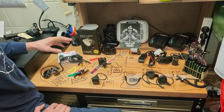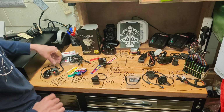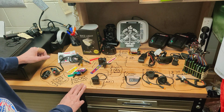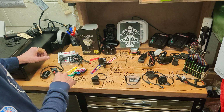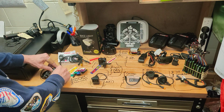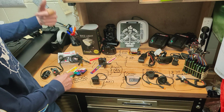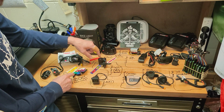But there's then also the harness here, which connects on your light and horn switch as a pass through and breaks out. Headlight isolation harness. So that allows you then to isolate your headlights, because this switch is only low and high beam now, you actually don't have a light on and off switch with this newer instrumentation. That's where this harness comes in. It's just got 3 wires on it. One plugs into the light switch, one plugs into your harness where the light switch would have plugged in, and it throws out another loop or 2 to go to an auxiliary switch.